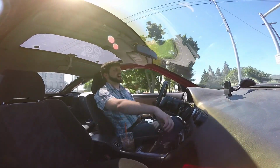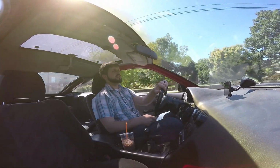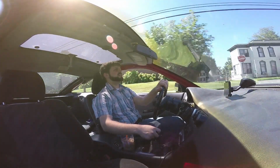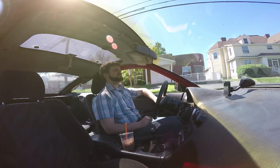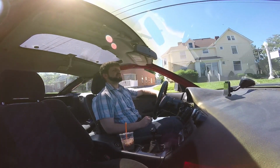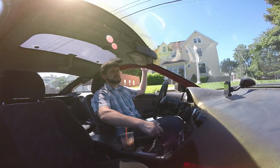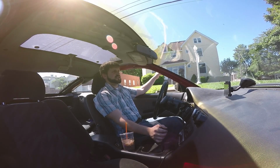Dodge Cummins, I believe, is what it came off. Now you don't have to go aftermarket turbo. The stock ones do put out a good amount of power, for what it is. If you do a bigger turbo, you'll probably have to upgrade the injectors. You can run the stock 2JZ injectors. Those will drop right in. They are side feeds on this engine.